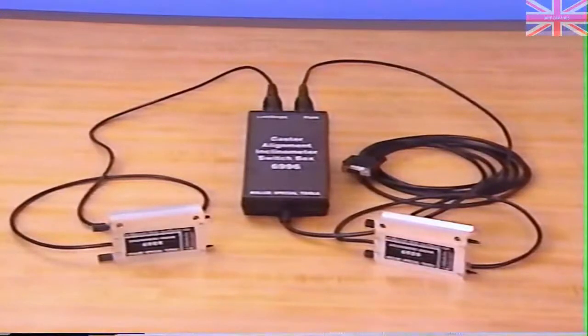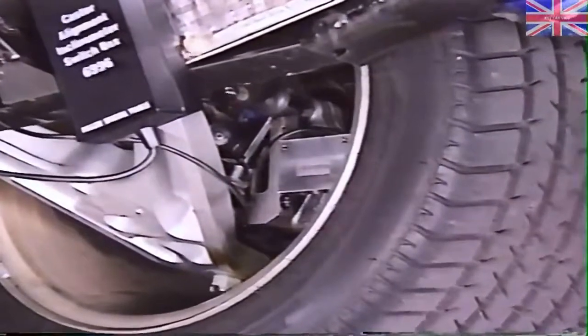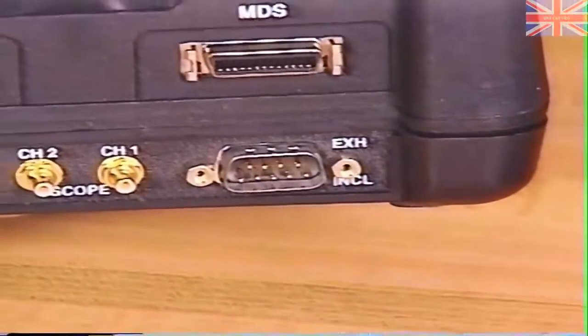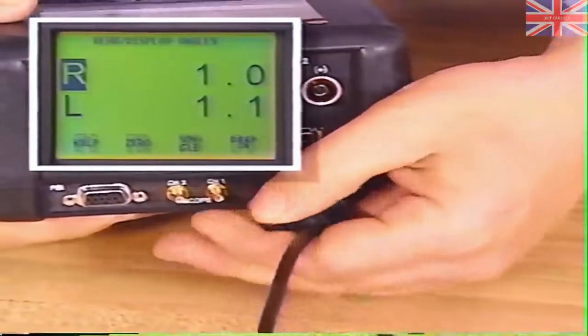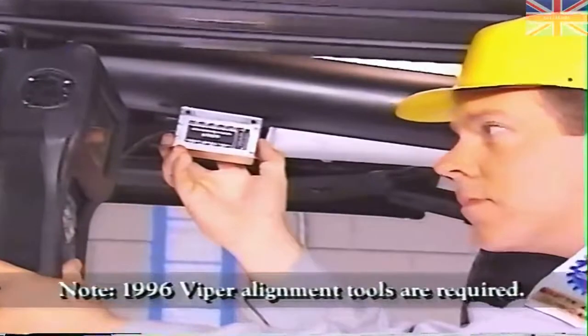The PEP module greatly increases the capabilities of the DRB-3 scan tool. In addition to the digital pressure tester and the dual-channel lab scope functions, the DRB-3 can now be used in conjunction with a couple of important tools. For Dodge Viper dealers, the PEP module enables you to use the DRB-3 as a display device for the Viper essential inclinometer tool. You should use the new multifunction PEP module in place of the inclinometer-only module you may already have. The Viper suspension was recently changed to aluminum components, and the inclinometer attaches to the control arms to measure the front and rear caster of the new Viper suspension. The DRB-3 becomes a display device when connected to the inclinometer through the powered serial port labeled INCL. The inclinometer can also be used to check drive shaft angle or any other angle on other vehicles.